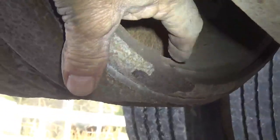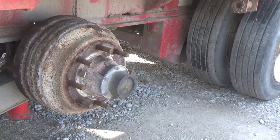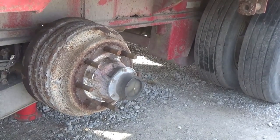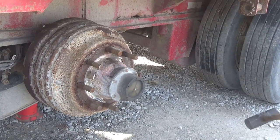I've got something a little disturbing — we'll find out when I get this apart. I was watching the bottom shoe and it's not giving me any gap. I looked up to watch this camshaft and it's rotating — see it rotating? Then I come over to see where my gap is and it's all on top. All my gap is on top, so something is wrong. That should not be like that — it should give me an equal amount of gap on top and on the bottom. So we'll find out what happened. I don't like being way underneath the trailer.